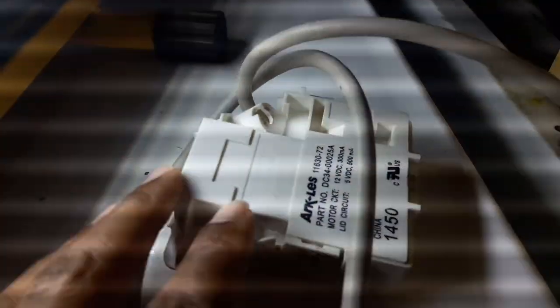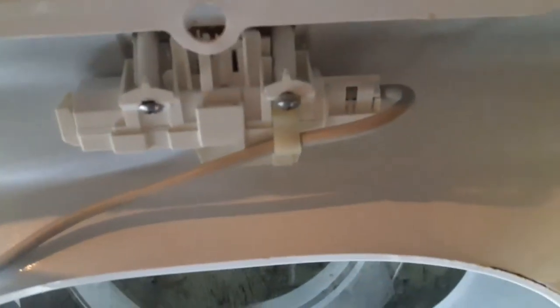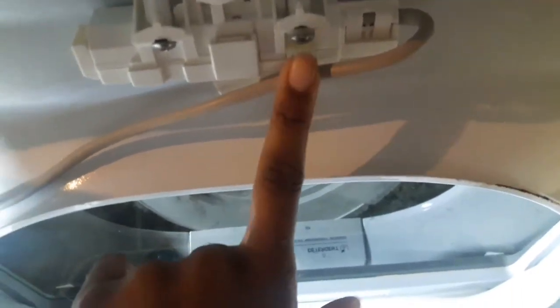Connect the old sensor and put the new sensor in. Make sure the door lock switch is lined up. On the old one I just took out, the door lock switch needs to line up with the hole — you need to be able to go in and out just like this little switch. Once everything is lined up and all screws and wires are secured on the door lock switch, line the wire around the edges of the door and twist it back into the twist ties that were originally placed there.